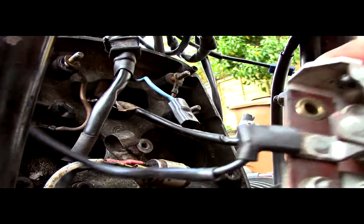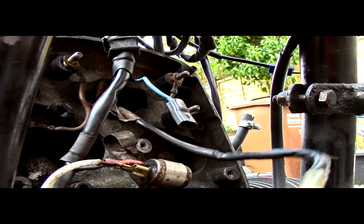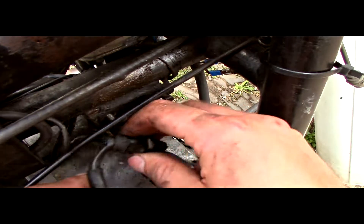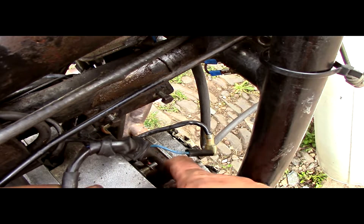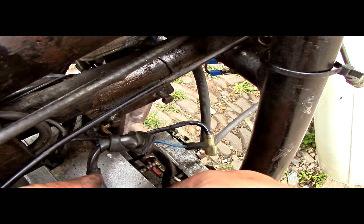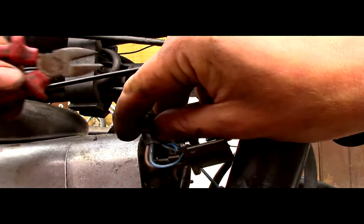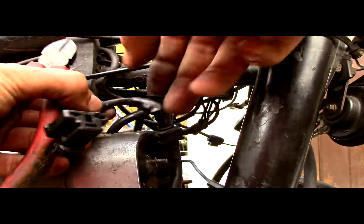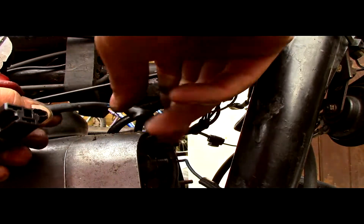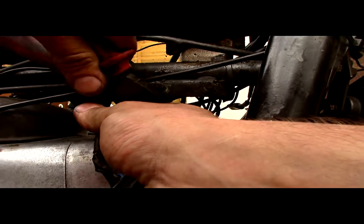So that's our diode board out. Next, you need to prepare the area by chopping out all the dead wiring. We've got to be careful because we've got a wire coming from the condenser that goes to the coils — make sure we don't chop that. But chop out all of this associated old diode board regulator wiring.